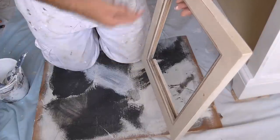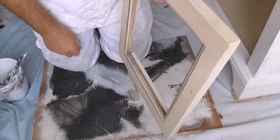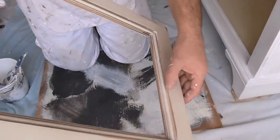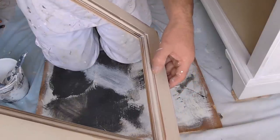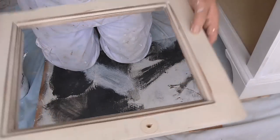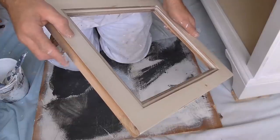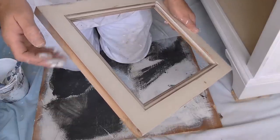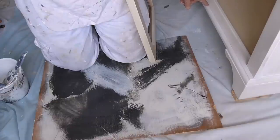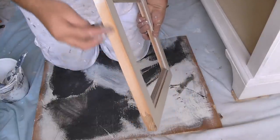So this is the door off the left side and top. Okay, we look at the underneath edge which hasn't been painted, and the underneath edges here and there, they haven't been painted either. So I will be painting these, but I won't be painting this. And the only reason why is if I put my paint on and the door sits back, it might end up rubbing down here because I'm putting paint here and I'm putting paint here as well. So I'm going to leave that just like they have.